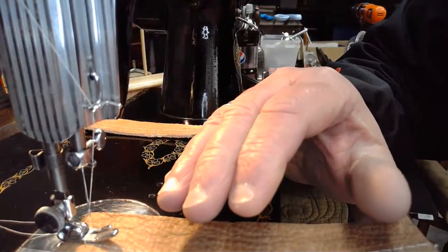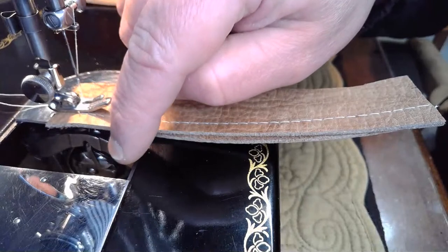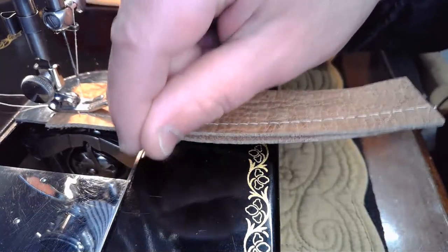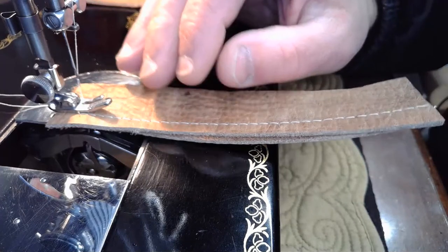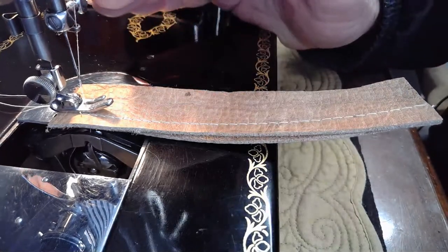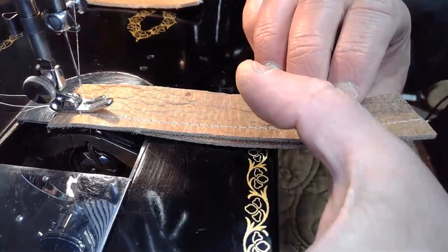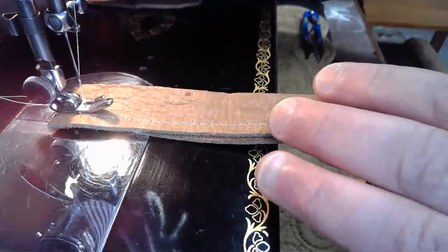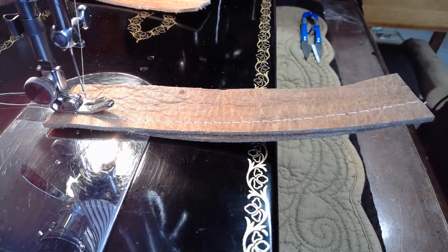Remember, when it comes to tension adjustments, the upper tension unit, this unit right here, is pulling up to define that lock stitch. The bobbin case down here is pulling down to define the top stitch. So when I just adjusted us from 4 to 5 on the upper tension, so we can get a little bit more pizzazz from that lock stitch, even though it's passable, we don't want to go too far because then we'll take away from this top stitch. Makes sense? So we've got to balance it. We've got to keep that tug of war fair so that both sides can maintain a nice balance and equilibrium as far as the stitch quality. All right, so let's go after this again.